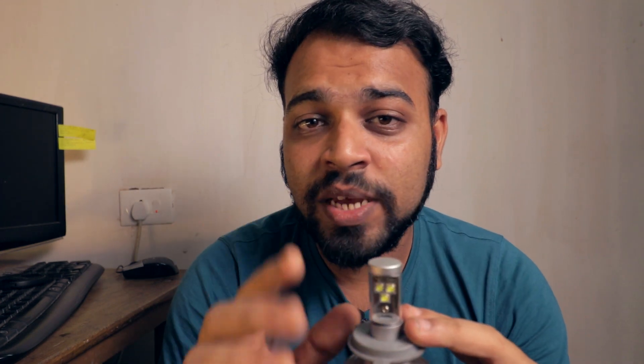Now, what's so special in this one? The unit for brightness of a bulb is lumens. A normal incandescent 35-watt bulb outputs around 600 lumens, and this Cree LED bulb outputs 1000 lumens per LED chip. So 1000 lumens into 3 LED chips is 3000 lumens! Yes, 3000 lumens at full beam. This bulb consumes 20-watt power and outputs 2000 lumens at low beam by lighting 2 LEDs. For high beam, it consumes 30-watt power to light up all 3 LEDs for 3000 lumens — that's 10 watts per Cree LED chip.